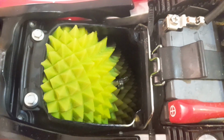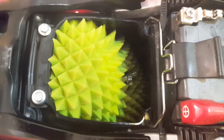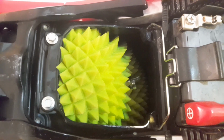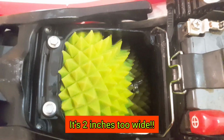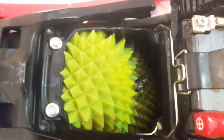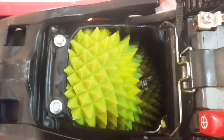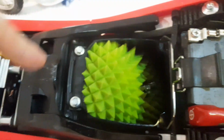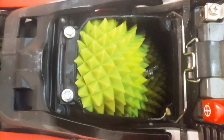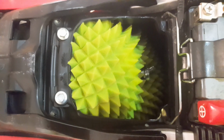Okay guys, and now we put a funnel web air filter on. They say on the forums that this should give it more power and throttle response. But I want to say that this brand is very hard to install because it has a loose fit. So the lip that goes around the air filter frame is not a tight fit, so I would say it's not that safe to mount without having a risk of error and not having the lip closing fully around the edges. So I would choose another brand, and the original actually has a really good fit, like the OEM filter. It also has a frame and safety hooks, 2 of them. So that's my advice for now.